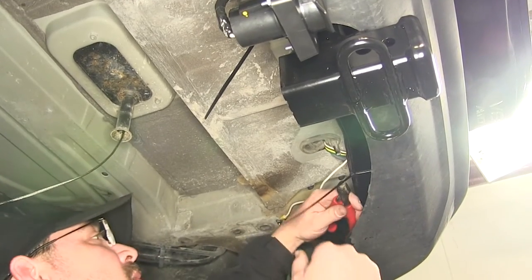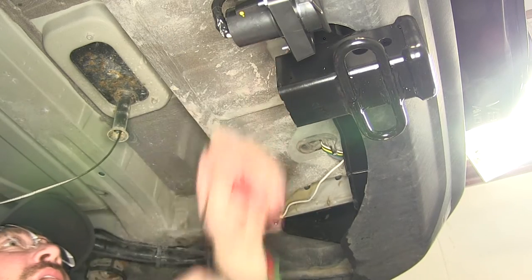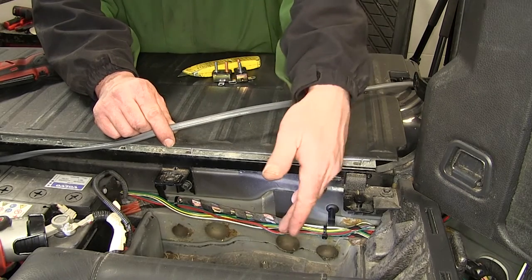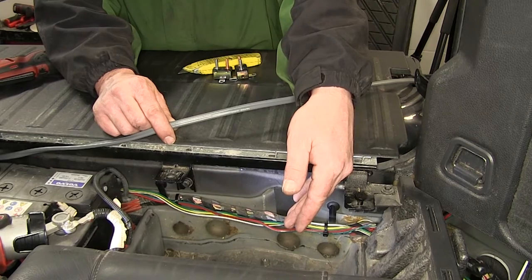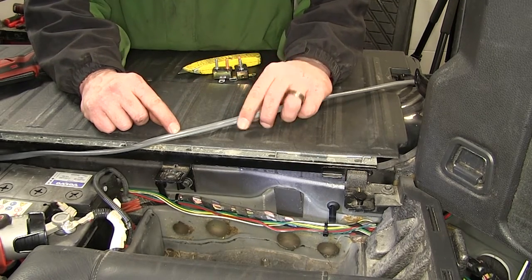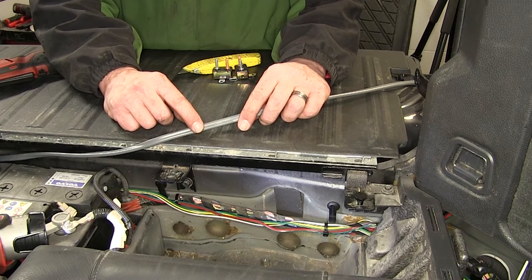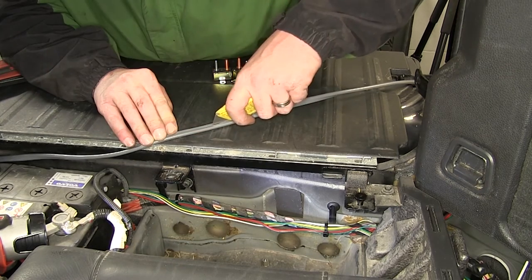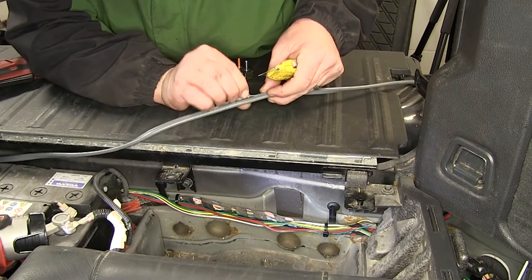Now with my wiring routed and secured underneath here, we're gonna go ahead and cut off the excess from the zip ties. Now that we have our gray duplex cable run inside, we're gonna mount the breakers in the lower storage compartment on the driver's side of the battery. So we'll need to peel back the sheathing of our gray duplex cable and cut the black wire that's gonna go to the breaker for the 12 volt hot supply that runs to the seven pole. Using my utility knife, I'm gonna give myself plenty of working room. Be real careful when removing the sheathing.